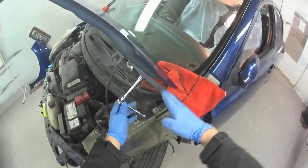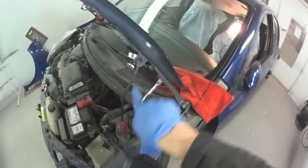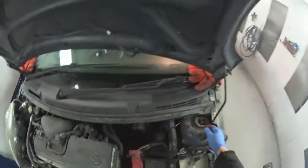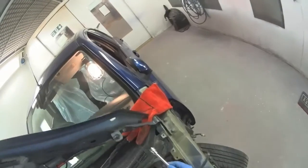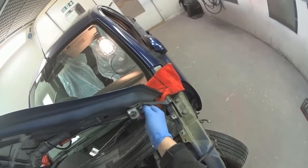This side is trying to lift up while the other was trying to sag down — the reason being we've got a lever going on there, with a fulcrum point. So I won't undo these completely until I've disconnected the bonnet prop. I'm using my hand to brace the bonnet — I'm lifting, I'm not just letting this bolt undo and watching the bonnet slump down; I'm actually physically holding it back.